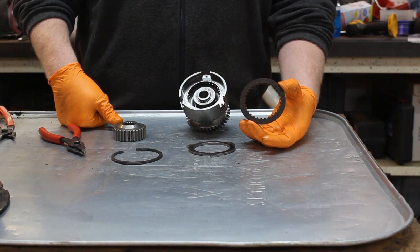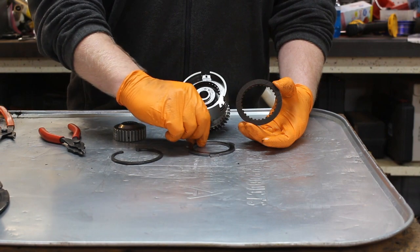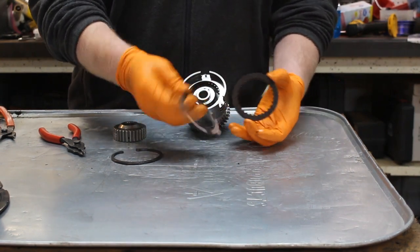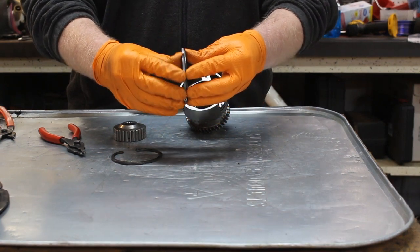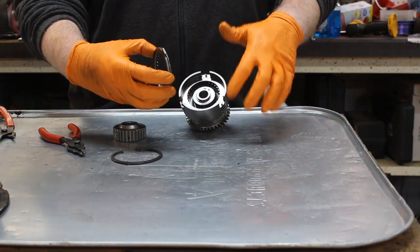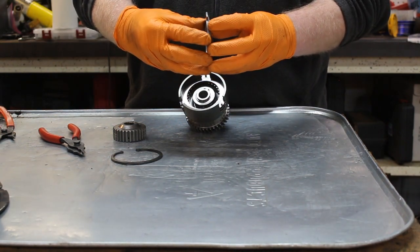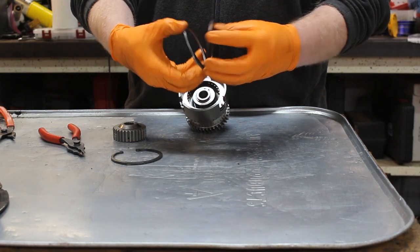Since this is a wet clutch system, this clutch plate has to have enough friction to bind or stop with that pressure plate right there. Same thing with this one — there are three total setups in there. What you don't want is these things slipping, because if they slip it causes excess wear.